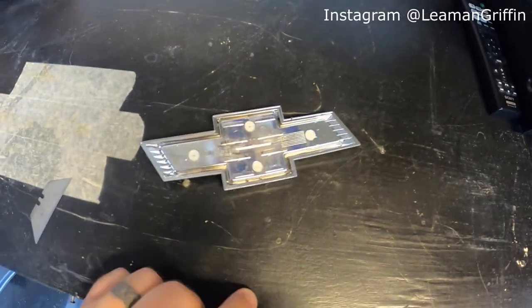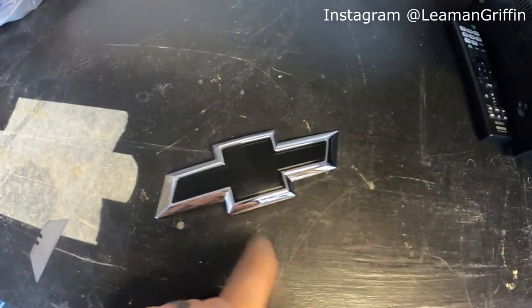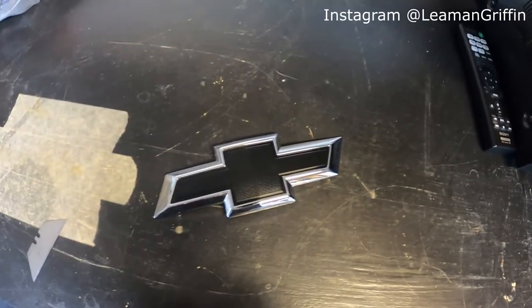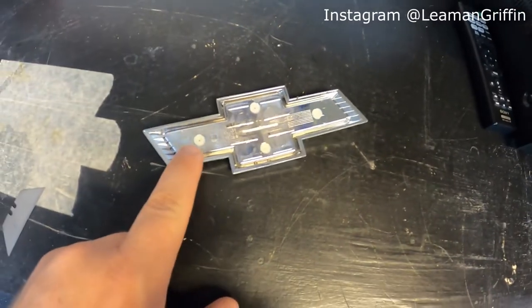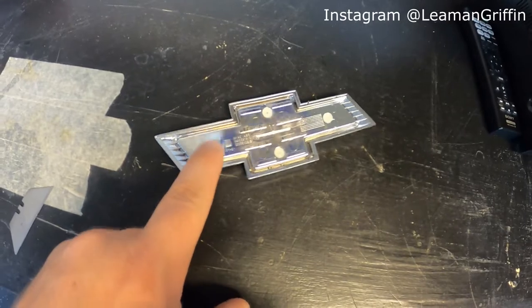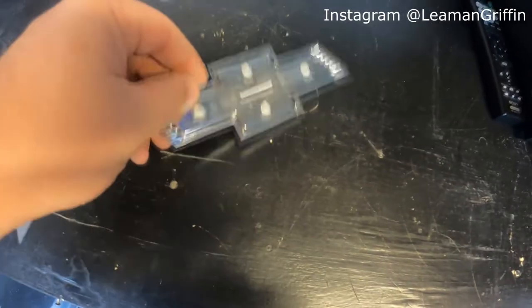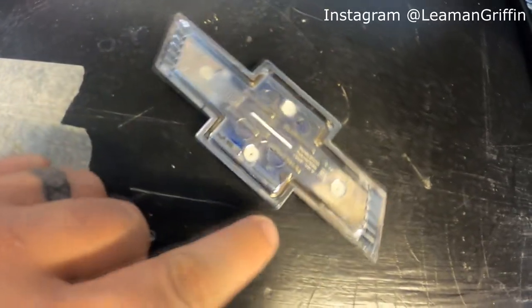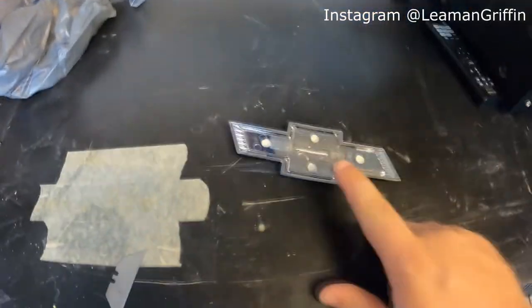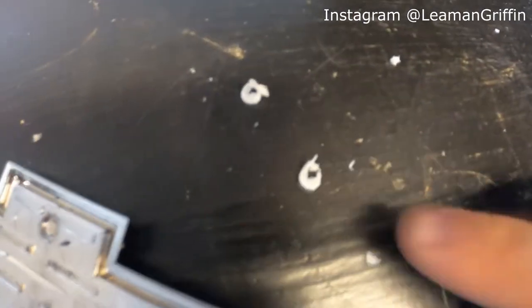I don't plan on reusing the center insert so I'm not too concerned about damaging the plastic welds. But if you're watching to learn how to wrap or disassemble this, you could probably wrap it without taking it apart. If you do want to take it apart, what I usually do is take a soldering gun, push down into the plastic weld to soften it, then get a pry in behind the black piece and lift it out. When you're done you can shove it back in, heat it up again, and smear it to hold it together — that's what I did on my truck when I wrapped the bowtie outer ring.